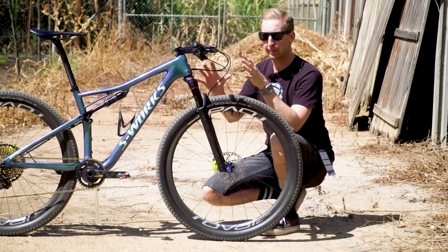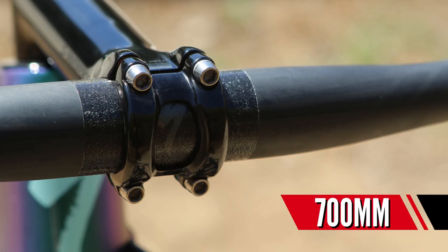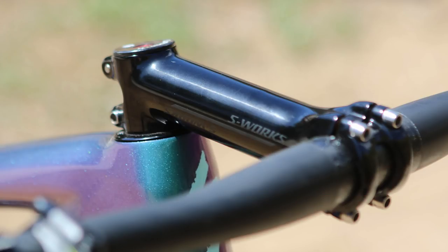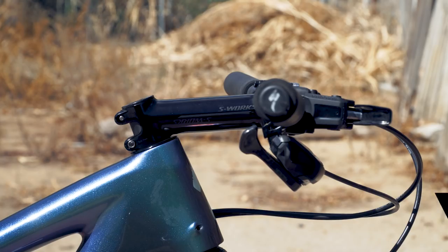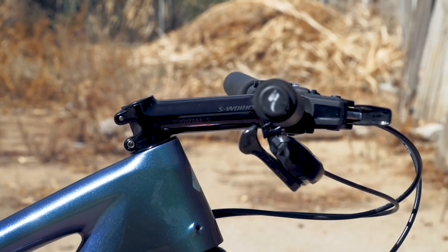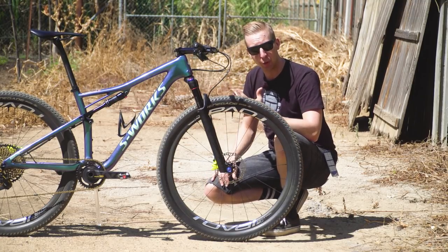The business end of the bike — the controls, the cockpit area — he's got quite a specific setup. It's a 700 millimetre nearly flat carbon bar, run with a 130 millimetre stem with a 17 degree rise, and he's got that inverted so it's completely slammed as low as it can be. That really reflects in his riding style. As you can see, there are no spacers on the top here at all — that's one of the lowest front ends we've seen. Quite unusual for a cross country racer is the angle of his brake levers, which are nearly flat — something you tend to see in gravity-based riding like downhill, but it does ultimately give you a lot more control on the bike.